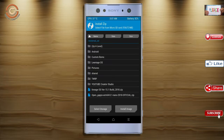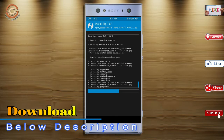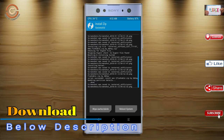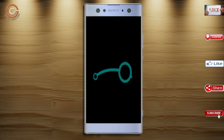Click on back. Select the GApps. After selecting these, swipe right to install. Before we proceed to reboot our system, we need to wipe temporary data. Select wipe and swipe right to wipe data. After finishing all steps, we need to reboot our system. Press on reboot system. Friends, it will take 2-3 minutes to reboot your device.